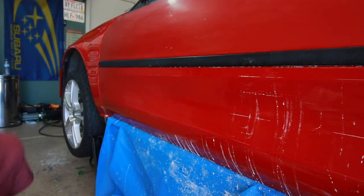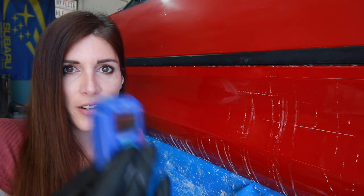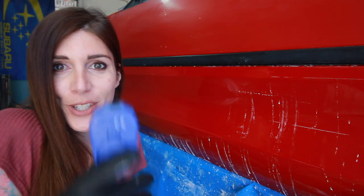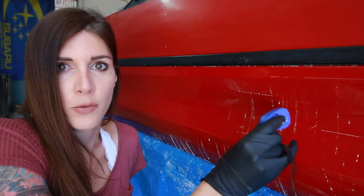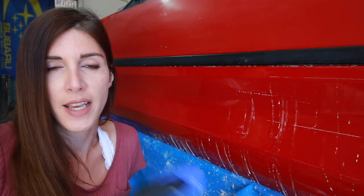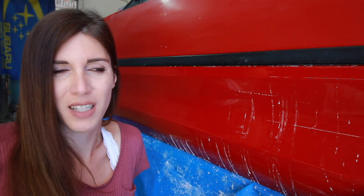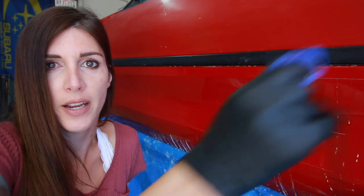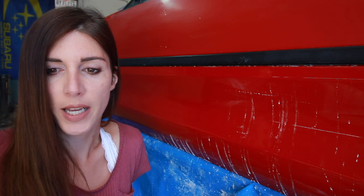What I also have is a paint thickness gauge. This thing was only about $15 on Amazon, so it's probably not the best quality. But what it's good for is: if I'm sanding one area too long, I can check that area in relation to an area around it and see just how thick that spot is. So it gives me at least a ballpark idea if I'm sanding too much in one spot — I check that area versus a less-sanded area next to it, and it lets me know.